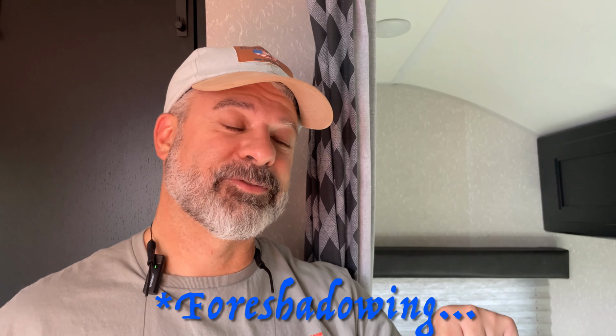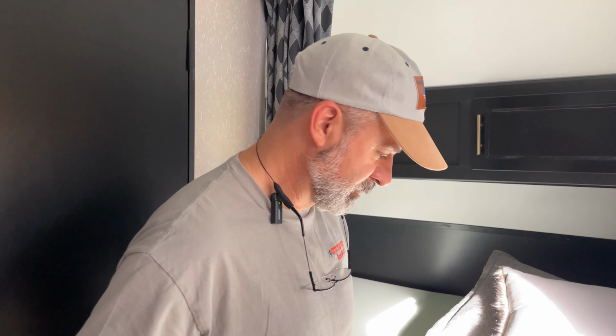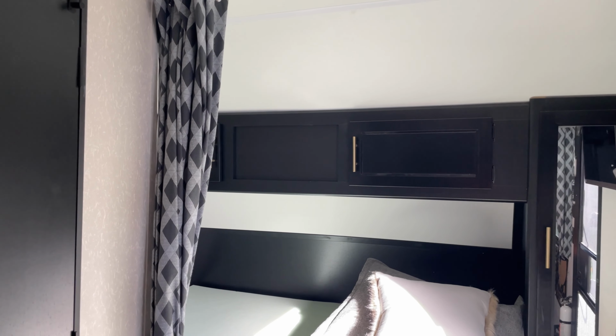So Dave, what if we forget to do that? Then we are putting antifreeze into our water heater, which holds 6 gallons. And considering I only bought 2 gallons of antifreeze, it wouldn't be the end of the world. You then just have to flush out your water heater. It's not going to hurt anything, but you're wasting a lot of antifreeze unnecessarily. Especially since I left the anode out. Right now it would just run out onto the ground. So it's not bad, but it would be a waste, right? Yeah, that was me.